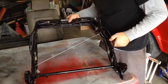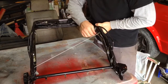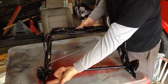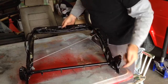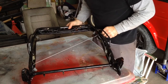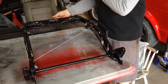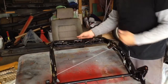We've got it all together now. You can see where we've basically looped the wire through here and then crimped it on each side. This side is the one that normally breaks on the seat — it runs across and then around to the hook and back. And then this side just runs straight down underneath and to the hook. Now you can see when I pull the lever, they open and close. So hopefully that does it. We're going to move on to the disassembly of that seat back and then hopefully we can switch everything over.